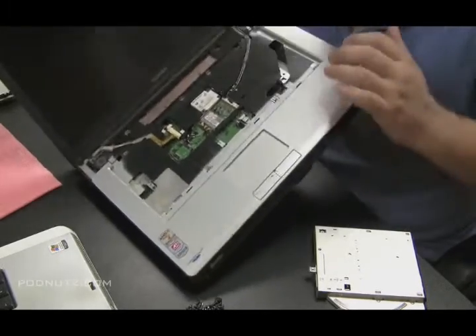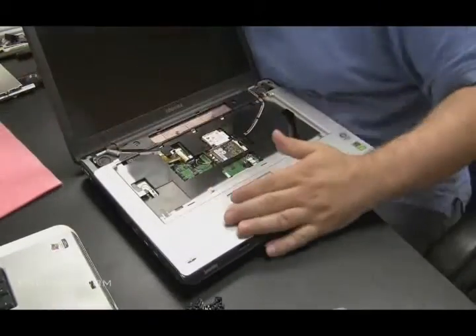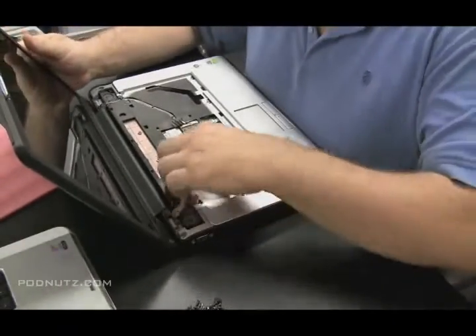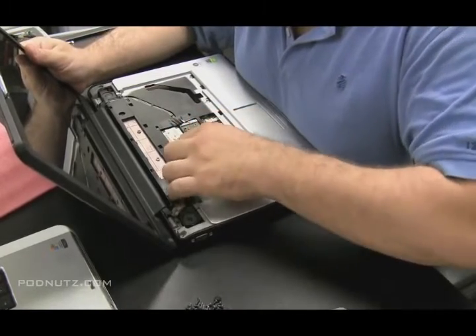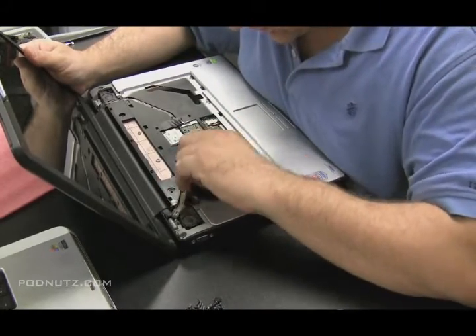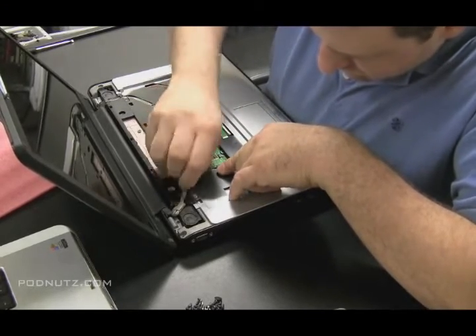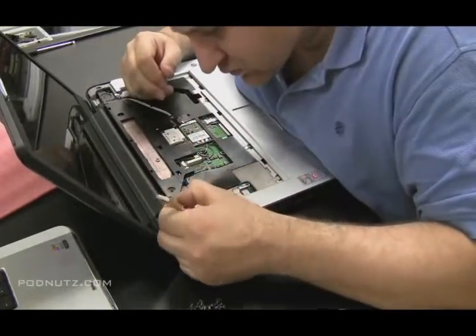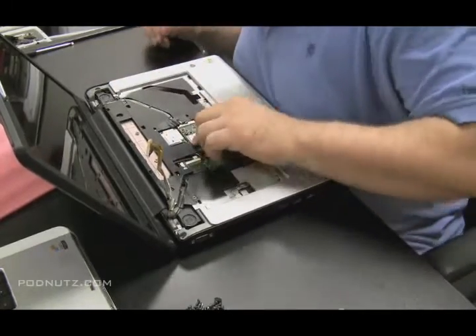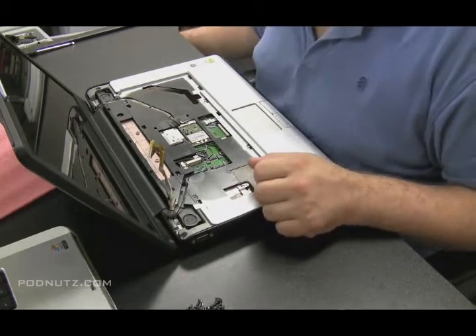Then look inside the computer at where the drive connects to the motherboard — there might be corrosion there too. Those are just some tips on how to treat a water damaged laptop: never turn it on, take it apart immediately, preferably take the whole thing apart to inspect every piece of the motherboard. Clean up anything you can, make sure there are no short circuits, and be as thorough as you can — this way you feel like you did everything you could for the customer. One last thing: check inside connectors like the LCD connector to see if any water seeped in there causing a problem. Thanks for watching.